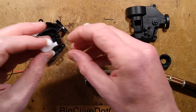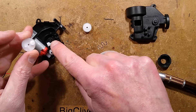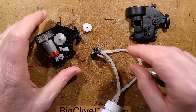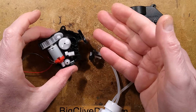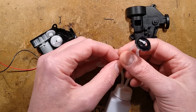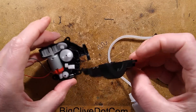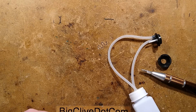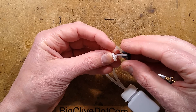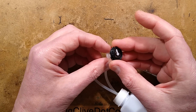There's the other bit of the peristaltic pump — it's got two little rollers on it that basically pinch that silicone tube and push it against the side of the housing. By doing so it pushes the liquid around in little pulses. It's a very simple pump with no complexity, because it really is just squeezing the liquid along this silicone pipe. There's another cogwheel that escaped — this is the one that goes onto the end of that shaft and couples on to drive the wiper arm.